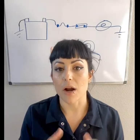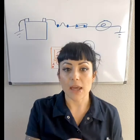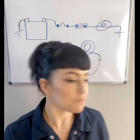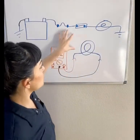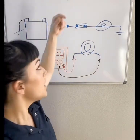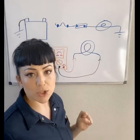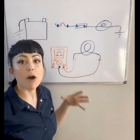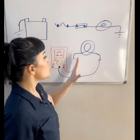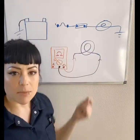For that reason, we don't hook up the meter in series or parallel because we need to hook up the meter when there's no power to the load at all — it actually needs to be completely disconnected. It's preferred if the component is isolated from the circuit, or at the very least disconnected from the battery. So if I was going to hook up my meter to the circuit I would have to completely disconnect my battery, pull the fuse, or disconnect a wire. I've got to disconnect power to the switch because my meter now becomes the battery and I can't have two competing batteries — I'm not going to get a reading.